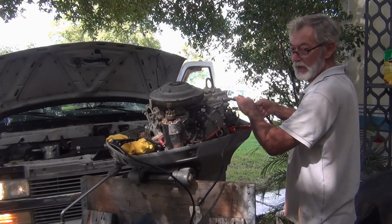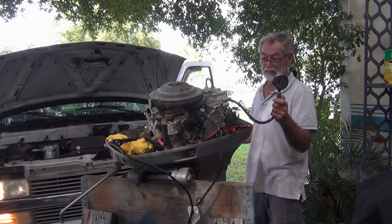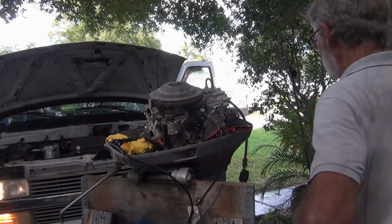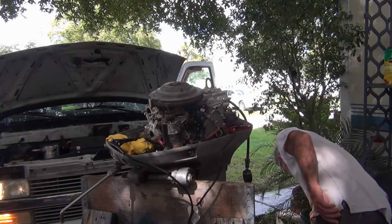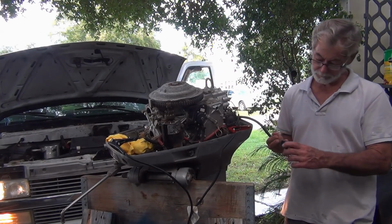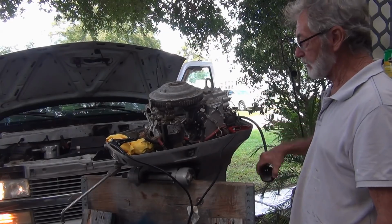I can't believe it's going to be that much of a difference. Damn it. Man, still at 170. How is that possible? That stuff stinks. 155 and 170? Well, let's throw a little bit more in the bottom and see what happens. I don't think I've ever had an outboard say 170. Actually 160. So 10 pounds difference. It's kind of hard to believe.